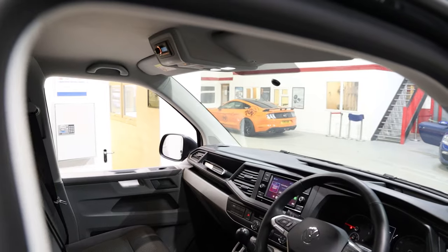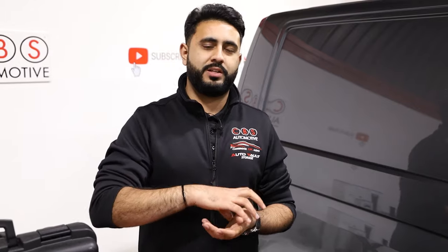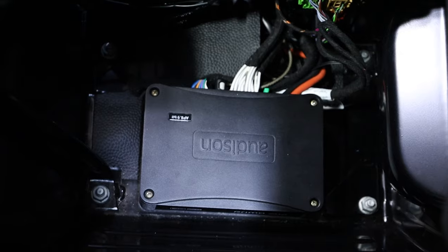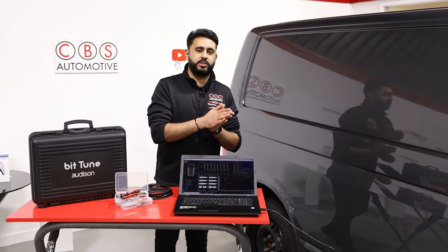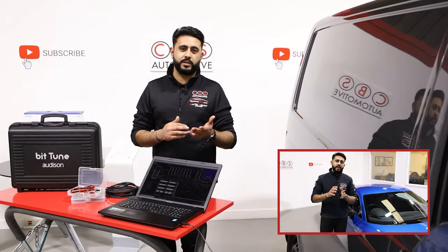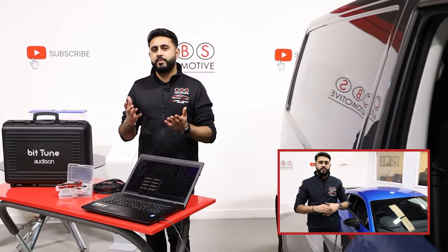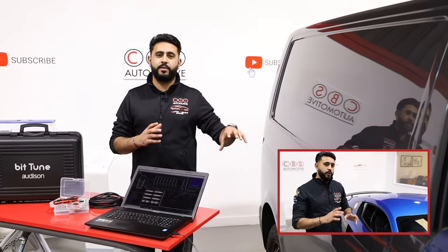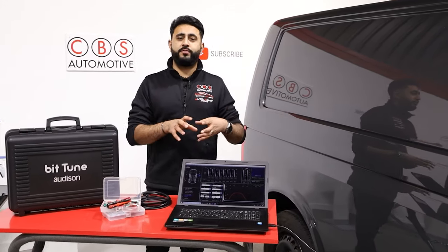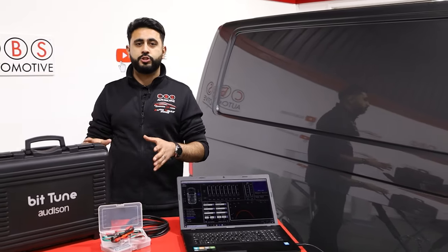The amplifier then goes out directly to the new speakers, and that's where you get an amazing, night-and-day difference in sound — while also retaining that original look, exactly like we've done in today's install. In terms of the processor, it's part of Audison's product range and it's actually built into the amplifier. It provides eight channels of amplification running at 85 watts per channel at four ohms, plus a processor built in — a really nice compact design. You would have seen it featured on our Audi R8 install and many other videos on our channel because it's a very neat bit of kit that sits within a really nice price point and has loads of functionality including the processing power, which allows us to tune the system as well.